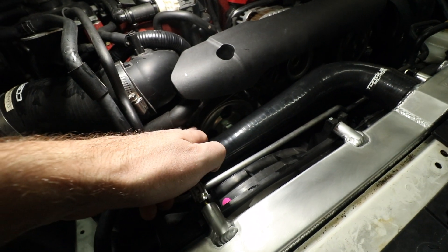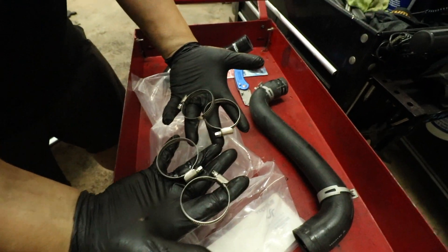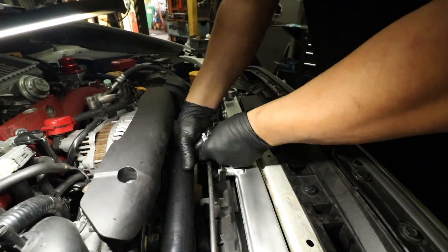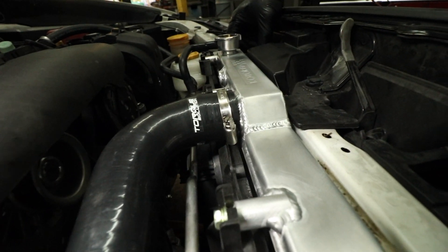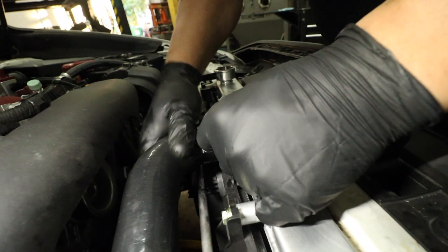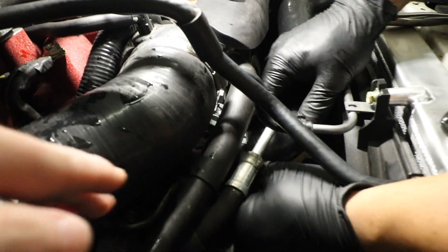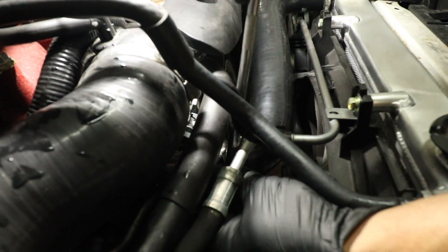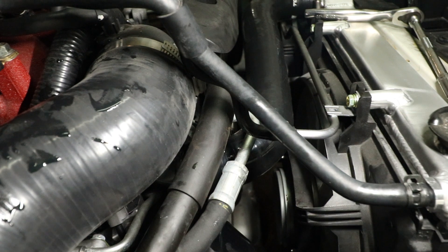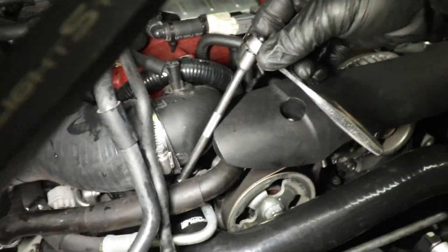Test fit first — make sure this is the angle you want and that the hose isn't touching the belt or the fans. Clearance looks good. They provide four clamps — two for the top and two for the bottom. Make sure you get the clamp over the fan area first, or it won't fit. Put the clamp on and then the hose onto the radiator. These clamps are 7 millimeter. With limited space, angle the clip so you can access the head. When putting the hose on, make sure it's over the coolant crossover pipe and feel it by hand — if it's not on there, the hose could pop off.